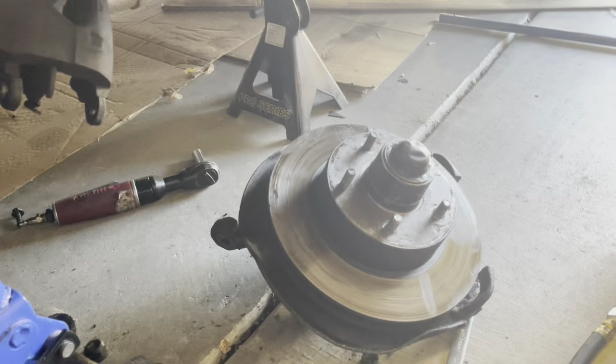Now I'm going to slowly lower the jack, and I'm going to stay out of the way of this spring. Again, you're doing this at your own risk. What should happen is I'll lower this down slowly and the spring will expand. I got the car up high enough that this will not hit the ground. And then when it's mostly expanded, I got less to worry about and I'll kick it. That spring should come out — I may have to pry it out with a pry bar.